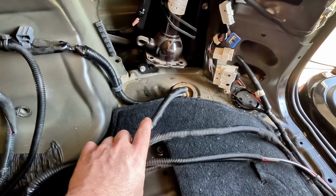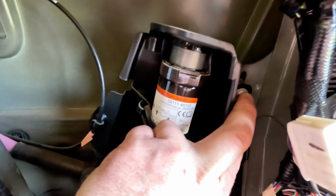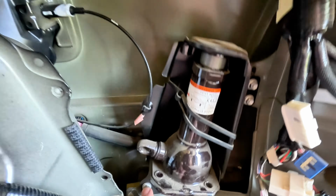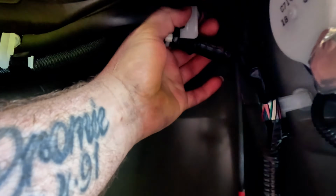So now I've got this wiring out of the way. That's the trailer plug and some other bits and pieces that were in there. You can see the jack bolts. There's two 10mm on the back side here and one down the bottom. So I'm going to remove that and then start mounting the compressor to the plate, which will pick up, I'm assuming, these couple of bolt points where this factory loom is pointed or tied to.